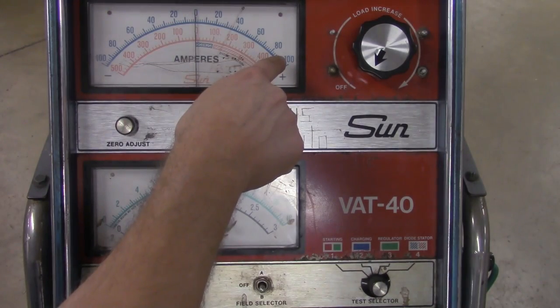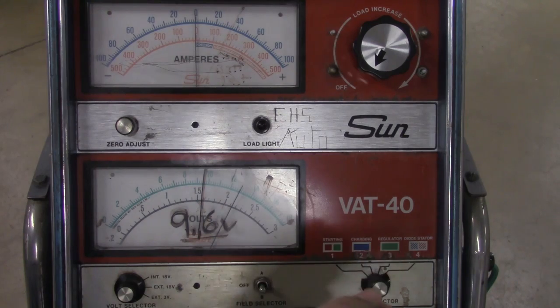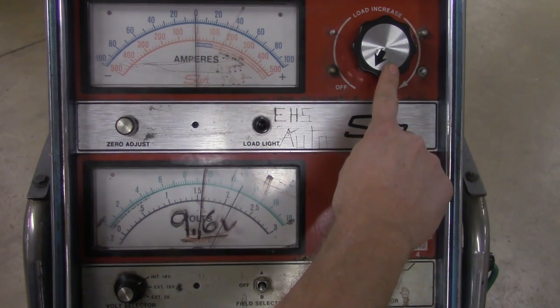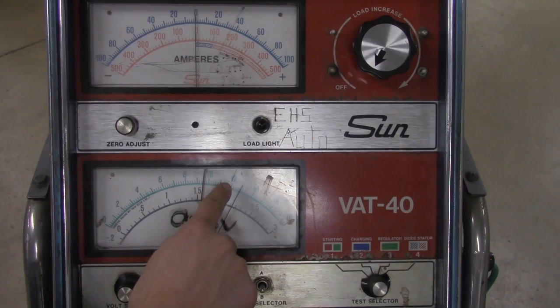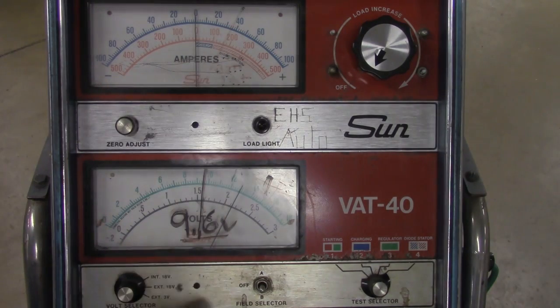I'm going to read the blue scale on top and the green scale below. When I start the vehicle I'm going to turn the overhead on — it'll get kind of loud. I'm going to rev the engine up to about 2,000 RPMs and hold it there. While I hold it there, I'm going to use the load increase and put a load on the battery, which will essentially load the charging system as well. I'm going to load the battery down to 12 volts. Once it hits 12 volts, I'm going to read how much output my alternator has to try to keep the battery charged above 12 volts. I won't hold it for any longer than about 15 seconds — for demonstration purposes, 5 to 7 seconds is more than sufficient for this test.